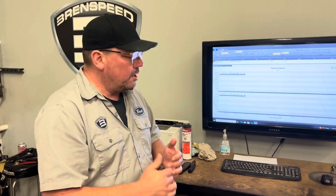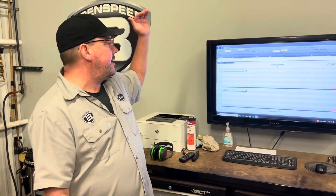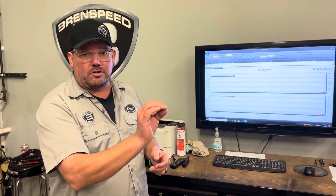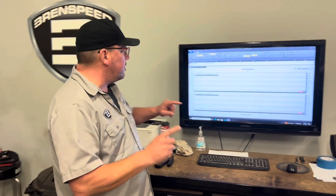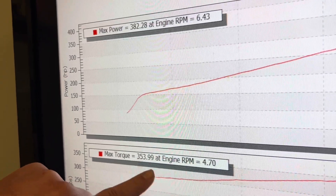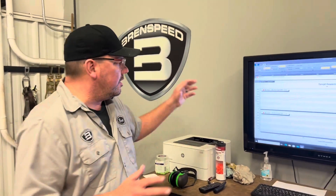After the pull, a couple things to address upfront: go through those three-valve videos and you'll see cars with basic bolt-on mods — not the engine, not the heads — laying down around 330 to 335 real horsepower on a manual transmission. That's pretty common. But this car laid down 382, maybe more. These are great numbers: 382 real horsepower peaking at 6,400 rpm, 353 lb-ft torque peaking at 4,700 — awesome power across the curve.